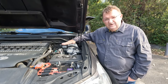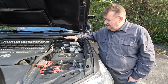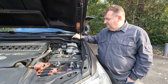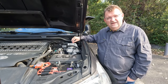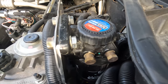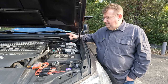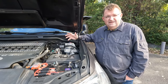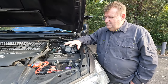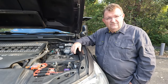I've got a Coupler-Tec anti-rust system through to the chassis — it's a six-pad one because it's a really long, large vehicle — and that helps reduce corrosion in the chassis. Just behind it I also have a Dieselcare secondary fuel filter. We hear about fuel quality issues sometimes, particularly in remote locations, so having both the stock factory fuel filter and a second one gives me a bit of extra risk management. Most of the rest under the bonnet — the radiator, cooling, etc. — is all factory and runs really well.